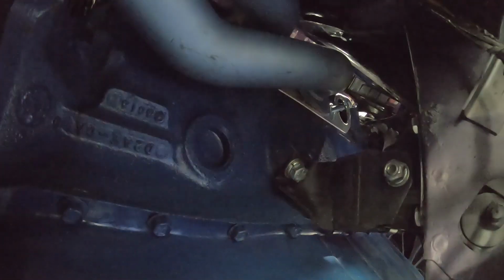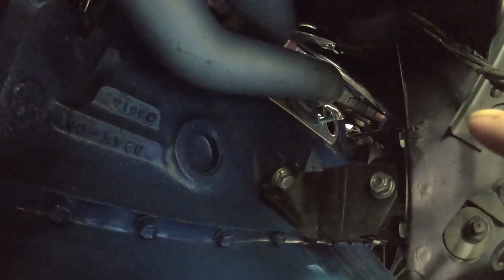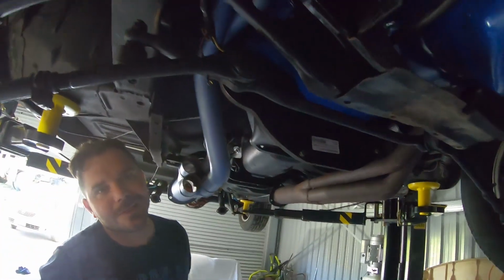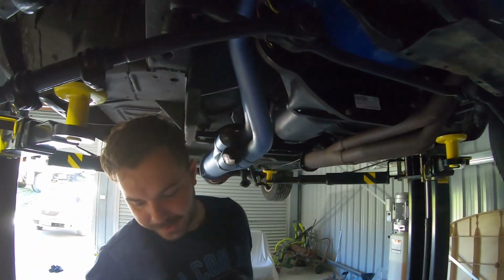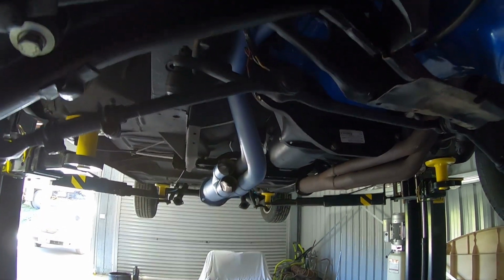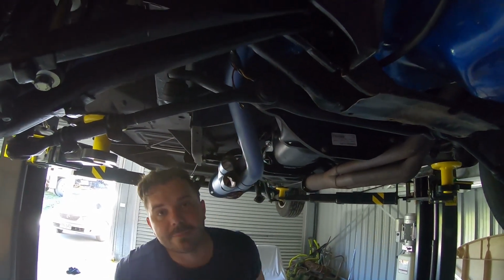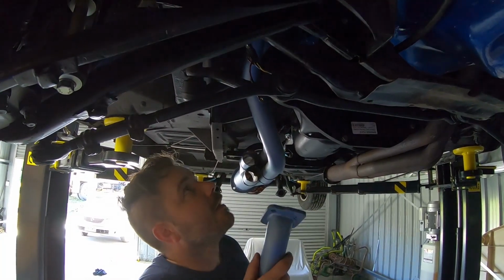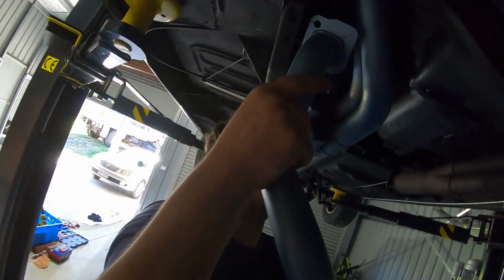See what we mean by leaving the bolts just started with the threads out, then you can hang the exhaust with the hanger on that lower stud there. And our old man taught us a few things that were good. One of them is always go for the hardest job first. Always go for the hardest bolt first, always go for the hardest task, and then the job just goes downhill from there. All right, so we'll try and get this back one in.